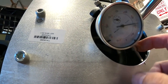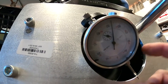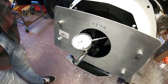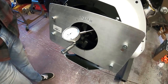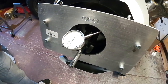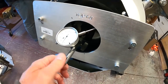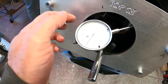The whole thing just went — we're going cattywampus here. This thing's slipping around. I've got to tighten everything back up. We had to redo our mount — it wasn't that sturdy. We were getting about ten and a half thousandths total between top and bottom, just a hair above where it should be, but the mount was moving. Now you touch the gauge and it's rock solid, so we're good to go.